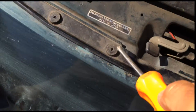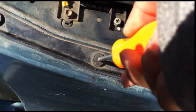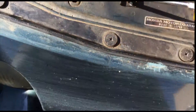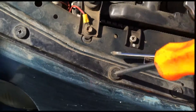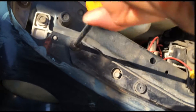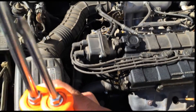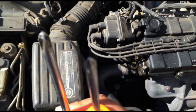If you try to use the number 2, it's going to strip the screw. I don't want to put any force in there because I don't want to strip it. The number 3 fits in there much better. That's why sometimes when you see these things all stripped out, it's because someone used the number 2. See the difference between a number 3 and a number 2?